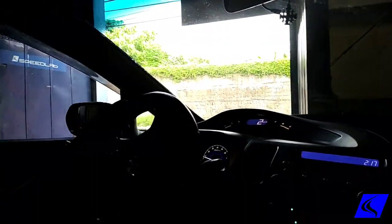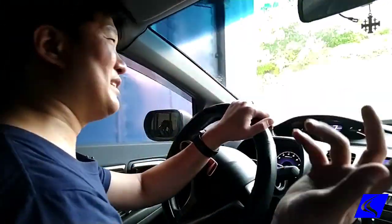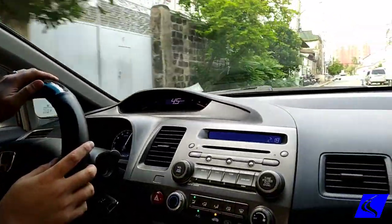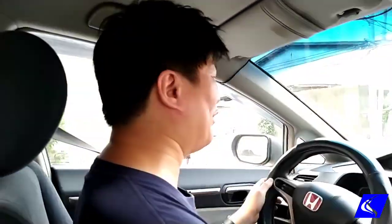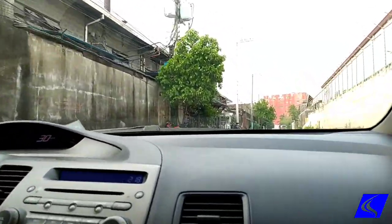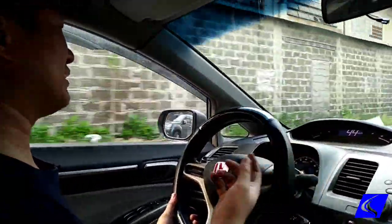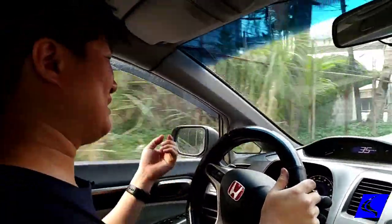Let's try out our newly tuned 1.8 Civic and see how it drives. We actually own a 1.8 Civic ourselves, so we know how it drives stock, modified, and turbocharged. There's definitely a lot more throttle response. Too bad this is only the Unichip Q version — if it were a Q4 we could sharpen the throttle response even more. Overall it shifts a little faster and I'm only at about 10% pedal. This is actually where the car saves fuel — you don't need to press as much pedal to get the same power and speed, so less pedal means less fuel consumption.